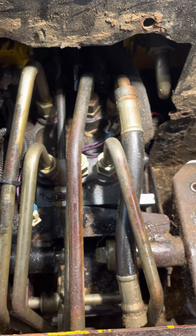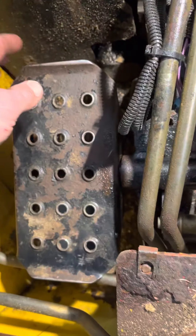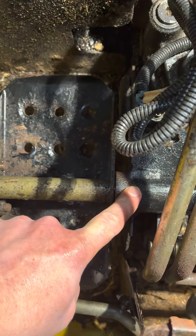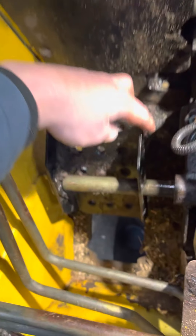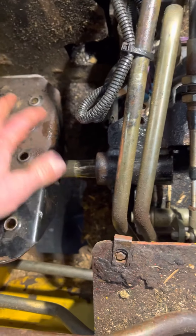Other than taking all the connections apart to get down in there, disconnect that from the plunger, knock out that roll pin, and take the cap off. In this case I had to beat the pedal off — actually I heated it up. I heated this section up without burning the wires and catching the thing on fire, because it just got rusted up inside there and wouldn't let the pedal do what it's supposed to do. So I heated it all up and then beat the pedal out. She just moves all over the place now — good to go. Beat it out, heat it up real good, work it around, and lube it up some more.